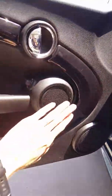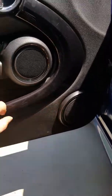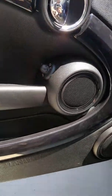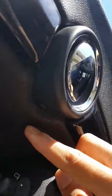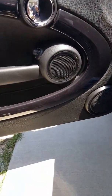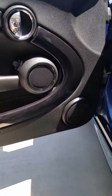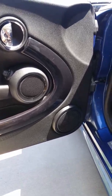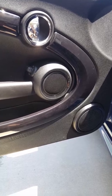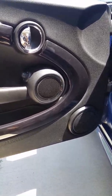For the driver's door, same thing — 4 inch and 6.5 inch. Just watch out for your mirror adjuster right here whenever you're popping that off. Again, still got the little pin up here that you'll have to pop out. I just cut the wires myself and spliced them that way, removing the factory wiring harness. But if you have any questions or comments, let me know.